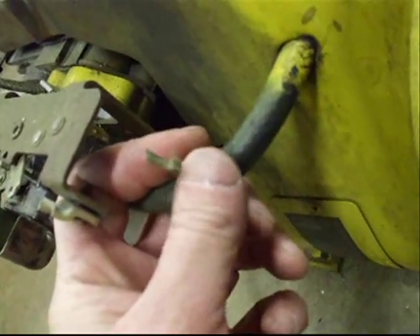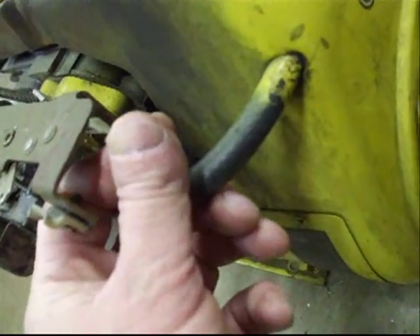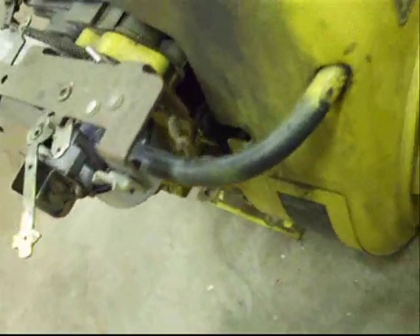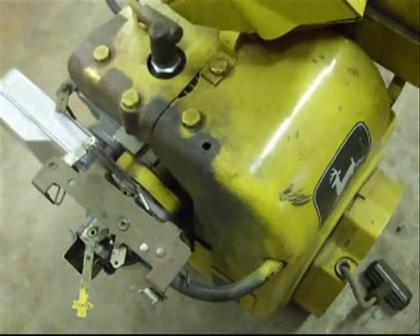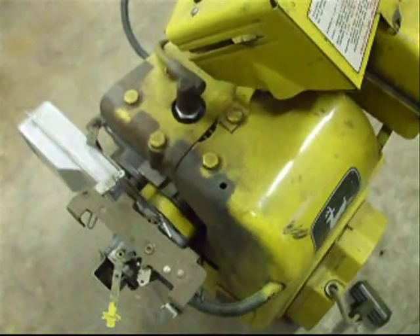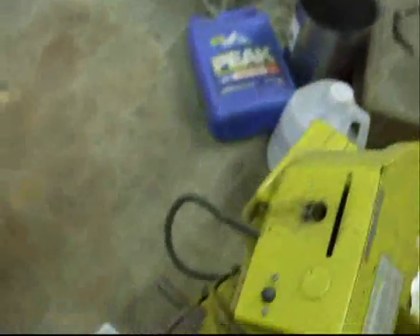As long as the engine operates, it will start. If we want to shut it off with this wire disconnected, we take it and touch it anywhere on the block and it will stall the engine out. That is basically how we start to set things up to test a new installation any time there is a modification.